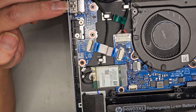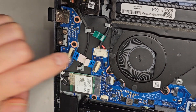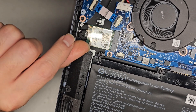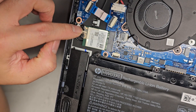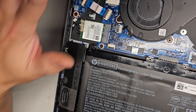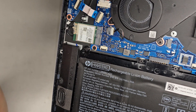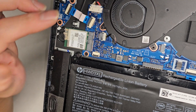You got this USB board here which connects to the motherboard with a flat ribbon cable — this is a ZIF or Zero Insertion Force cable with a little lock. You got this wireless card here. To remove that, you'll have to peel this plastic adhesive rectangle thing out. To remove the antenna, pull from the tail straight up and it will pop out. I'm not going to mess around removing stuff I don't need to, because sometimes the solder can be done poorly and things can break off, and the customer will wonder why other things are broken when the only issue was the SSD.